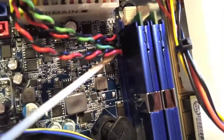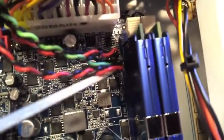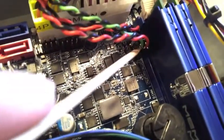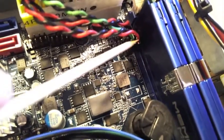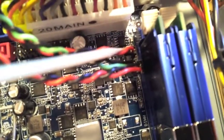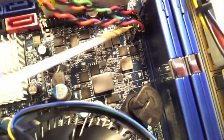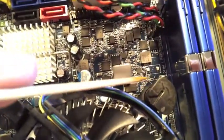It's kind of hard to see here, but there are only a few spots, and the nice thing about the Intel motherboards, they come with pretty good documentation in terms of the visuals, so we can see where these attachments are. And they're actually color-coded on the motherboard too, but I've got these plugged in so you can't see them. But you'll notice here that the colored wires are all facing towards the inside of the case. Those are the positives on those LEDs. Those are pretty important. The power switch, less important. This is just going to make or break the circuit. So there's not really a positive or negative. It doesn't really matter how it attaches. But these other two LEDs, the green LED and the red LED, should be on the inside of the case.